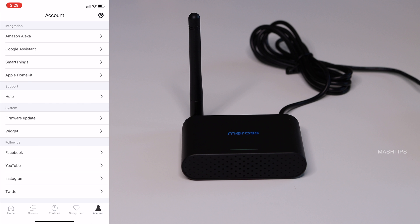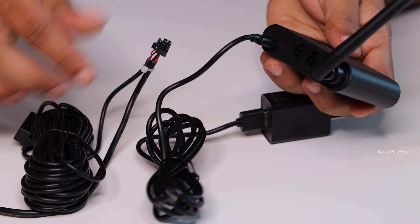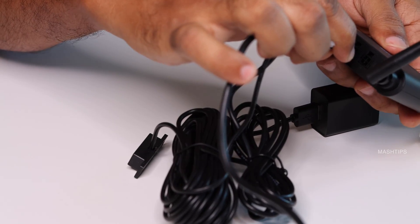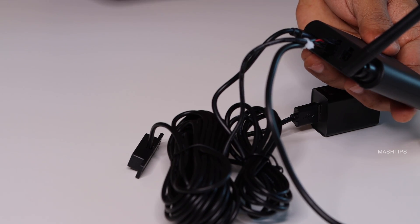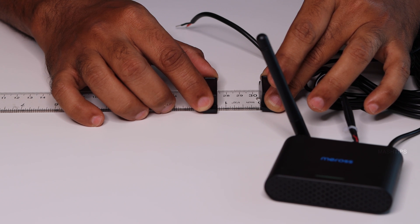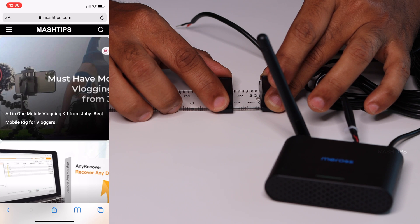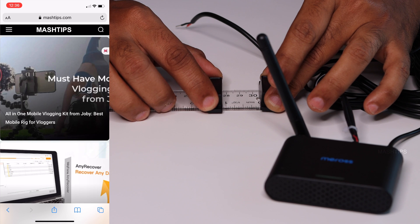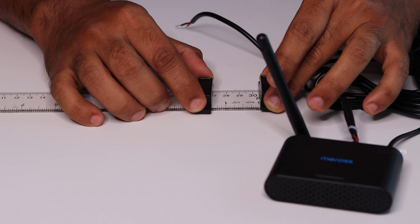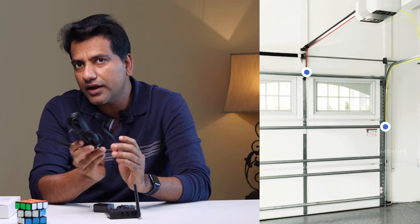You can set up Amazon Alexa or Google Assistant right from your Meross app. For Android users, you can also use the Meross app to configure Amazon Alexa or Google Assistant. Before you move on to your garage door, insert your control wires into the device and make sure it is working — select the port you want and insert the control wire. Connect the power supply and use the reed switch to demonstrate: move the reed switch close to the magnet and you get a pop-up on your mobile phone showing door closed or open. Move it back and make sure both status readings are working fine.